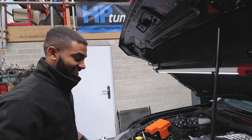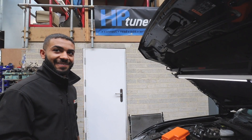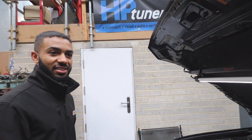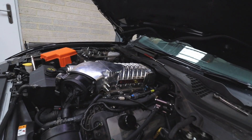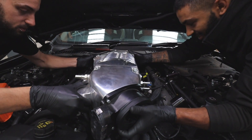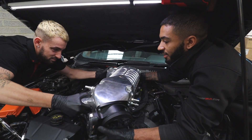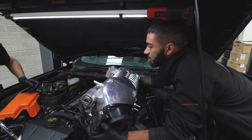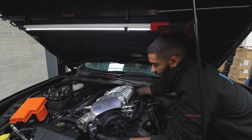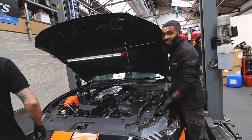Called in the henchman to help lift the supercharger off. There's a bypass valve connected underneath it — that's why it was stuck. Round two: try it with the bypass valve disconnected this time.